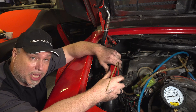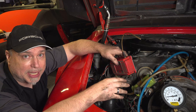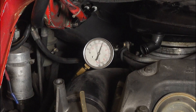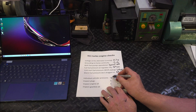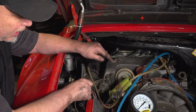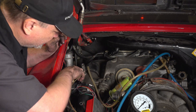Definitely want to keep that Boost Timing Master in mind — let's work around it, keep it here, pull it out and see what it's connected to. Number three compression is about 130. I think this Boost Timing Master was probably supposed to be plugged right into there, because this is connected to the manifold, and I guarantee this is going to produce a vacuum leak — this port is after the sensor plate, so this isn't going to be very good. It looks like it was just crammed in there. That'll create a vacuum leak. Number two compression is about 132.